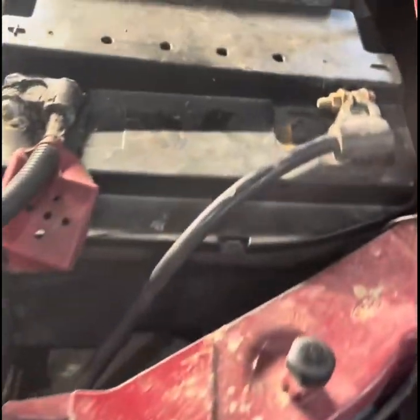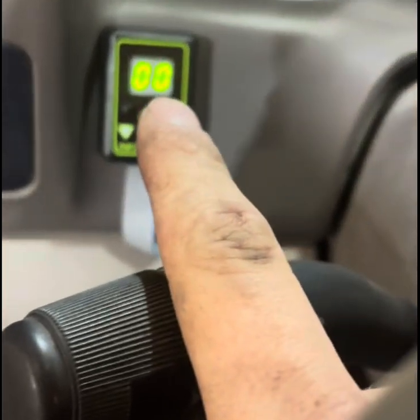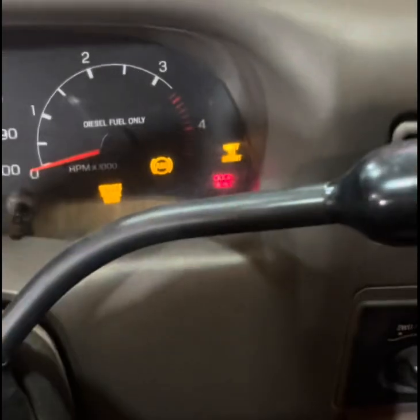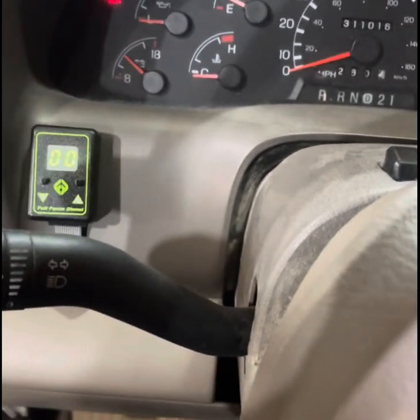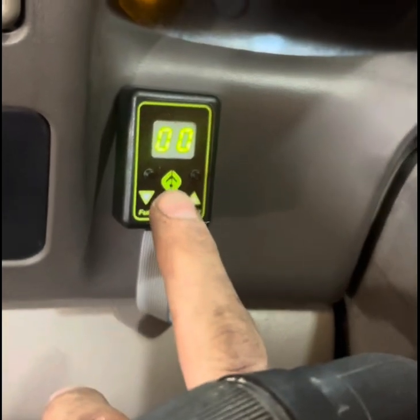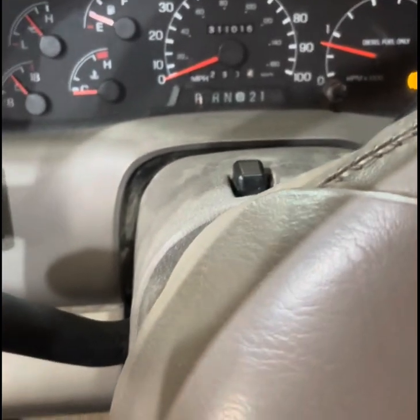Now that I've got both batteries hooked back up and everything's installed, we're going to hop inside, flip the key but not start the truck yet. If the glow plug light turns on — wait to start — the hydrochip has power, that's a good sign. Cycle it one more time just to make sure. Got hydrochip power, normal lights, go for first start. We're on the stock tune right now, zero zero. Everything is running smooth, all the gauges are fine, nothing's freaking out. ABS light is on but it normally is.